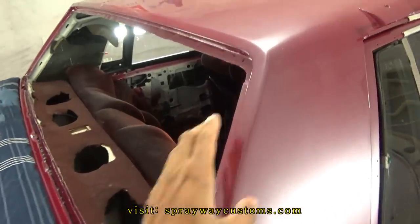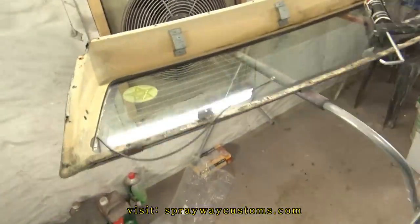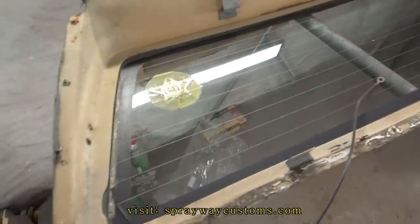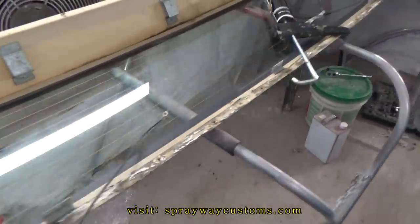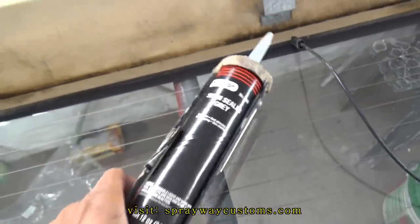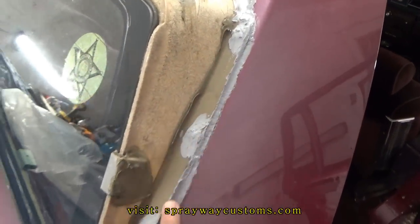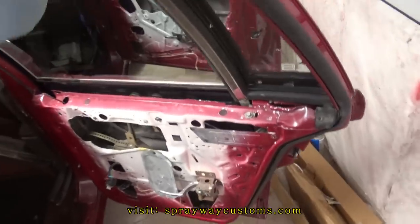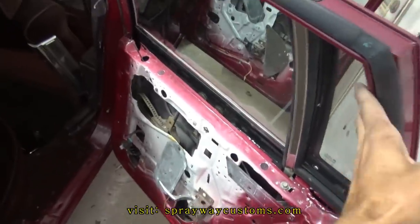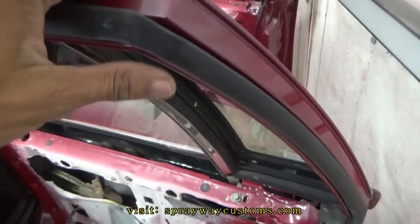Bagged the car in. I'm finna go ahead and put this rear glass in. I just threw a blanket up here trying to protect the paint. But I got it sitting over here. It looked like from the factory they just seamed up the bottom. And once they put it on, they went around the edge and seamed it up. I just got some seam sealer here. The sealer about dry. I got one of the weather stripping for the doors on. It's a tight seal now.